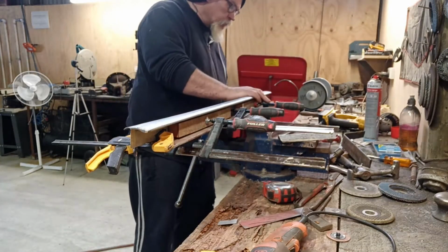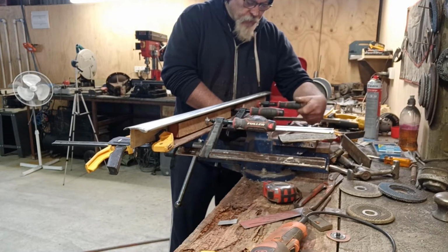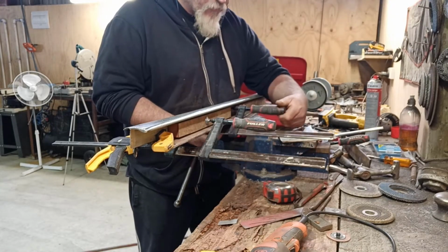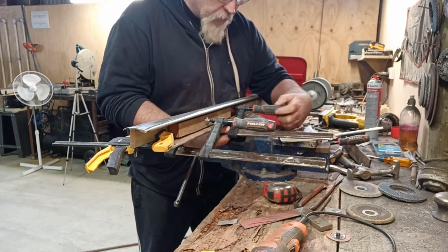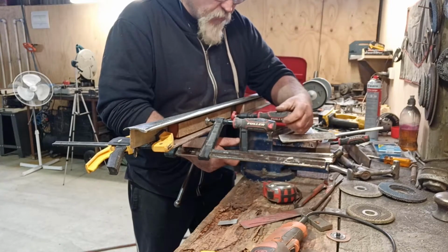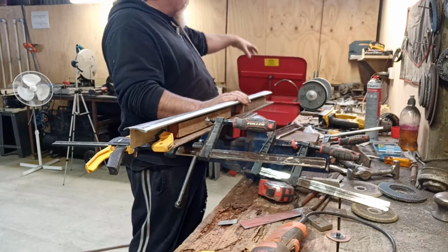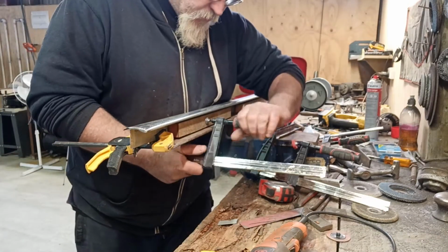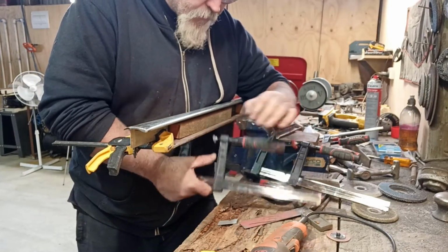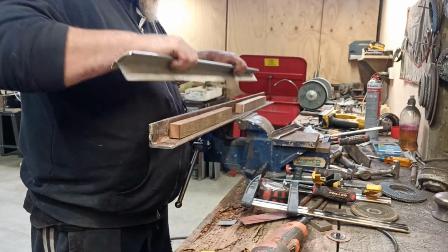Not too bad there now. That other thing would have been probably run through a series of rollers or something like that to make it originally. It might have gone through sort of 10 form rollers, and it would have slowly got into that shape. They would have just run it out in big lengths and then cut it off to whatever length they wanted and pulled it around a mould and shrunk it and whatever, to fit whatever seat base I wanted to use it on.